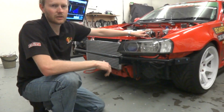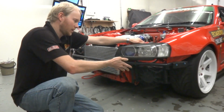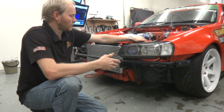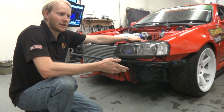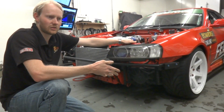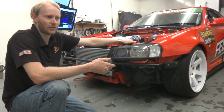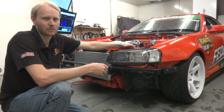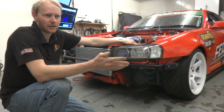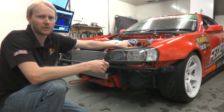The ECU also reads the oil temperature, and at the temperature that we configure, the thermo fan comes on for that as well. The fans are all configured to not run unless the engine speed is above 600 RPM. That way if the battery's a little bit sad, the engine's not trying to run 3 fans as well as crank the engine if the car happens to be hot enough to require so. So it'll start with no current draw from the fans. Once the engine speed exceeds 600, the fans cut in and run as per the temperature thresholds that we've configured.